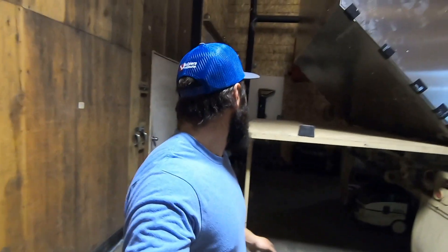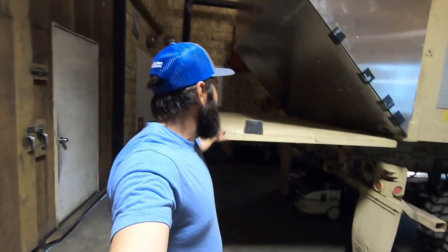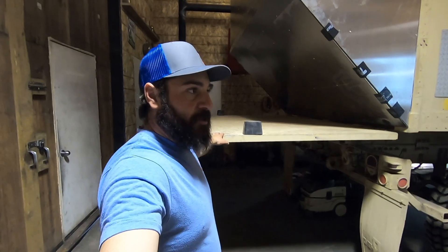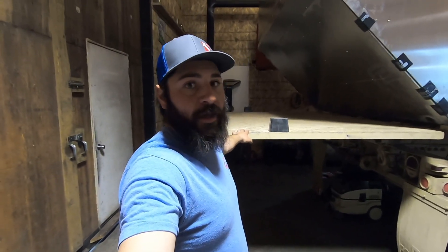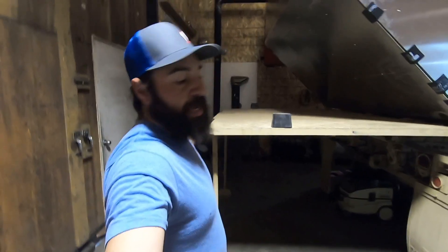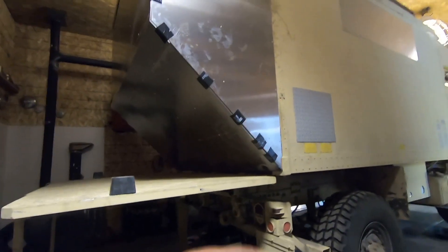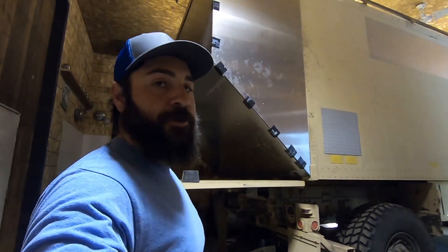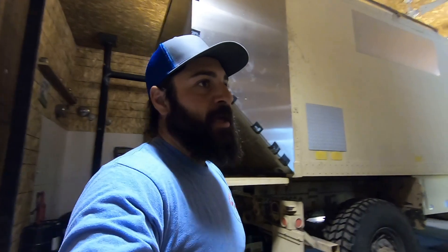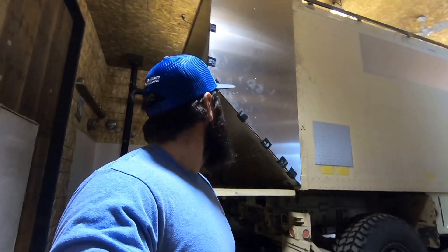Moving on to the back of the truck here, you can see I've got this pretty cool patio. This was actually original — this was a commanding officer's truck and was originally more of an RV than anything. So it had this porch on it as well as a staircase that comes down off of it, which I'm repairing right now. Here's the box extension that I've built. It's all built out of 16 gauge steel, 2x2 steel. I know a lot of guys use aluminum — I'm not that good of an aluminum welder, just to be completely honest. So I'm sticking with steel, something that I'm good at working with. And I've skinned it in 16 gauge aluminum.